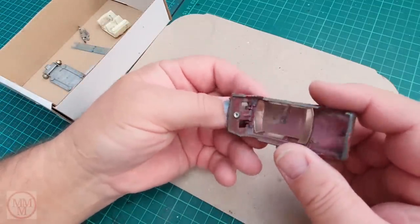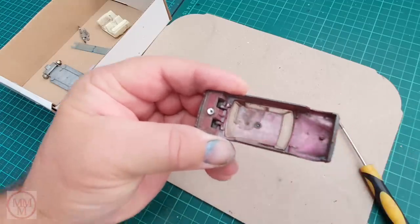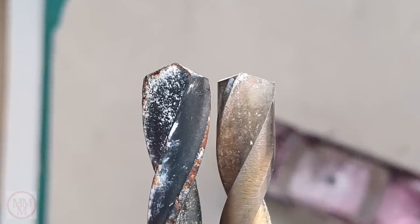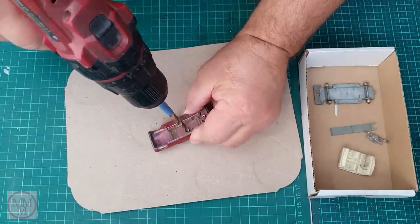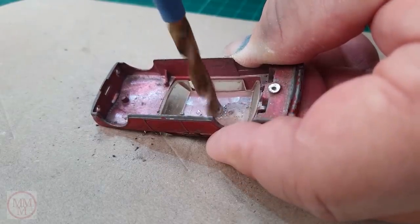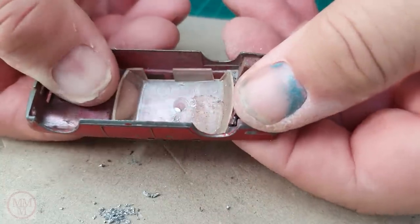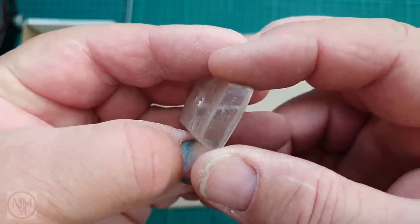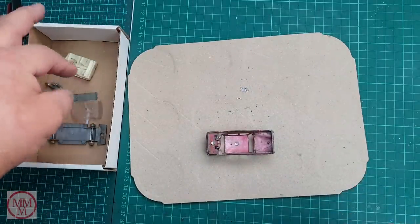I was going to remove the boot, but looking at it I run the risk of breaking the hinge points if I try and force it apart, so I'm going to leave that. Instead I'm moving straight on to removal of the plastic windscreen. I'm using a shallow cut drill — this reduces the risk of drilling into the roof and possibly punching through, or creating a dimple visible in the end result. I'm not pushing on it, just using the weight of the drill mainly. And once you've gotten most of it away, actually that came out easier than normal — just light finger pressure and it just fell out, which is even better. Having a look at it, it's a little bit scuffed but no cracks, so I should be able to polish it up later.